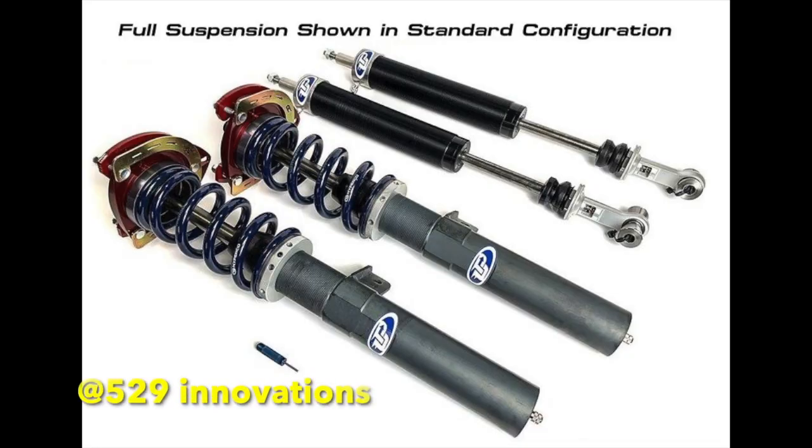This combination is going to get even less squat once I have real struts - where you can control how fast the suspension goes down and comes back up with two-way adjustability. I'll make another video once we do that, but it's going to be a whole process - adjusting bump stops, corner-weighting the car to balance left-to-right and front-to-rear. On my Mk7 I knew a little but not a lot; now I know more and I can set this car up properly.